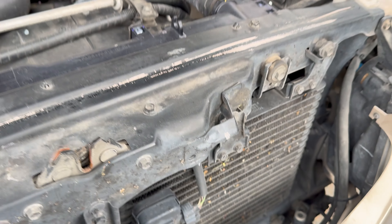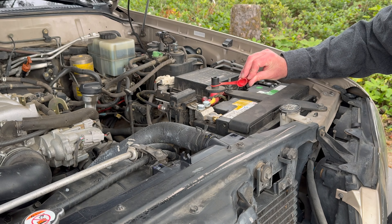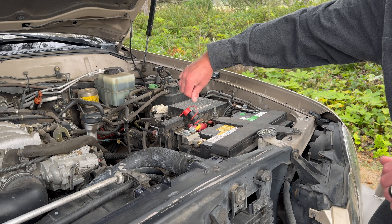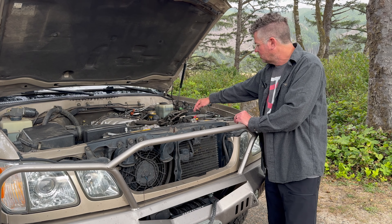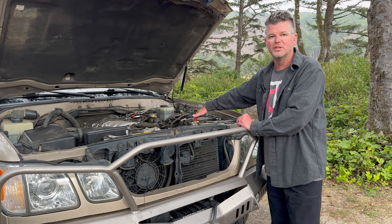I also added a switch here. This takes a totally separate marine-style switch to bring power to the winch. It's something a lot of people don't think about when you add a winch — you're running positive cables down from your battery to the winch, and if you're ever in any kind of accident, that can cause a fire. So putting a shutoff switch really close to your battery is just a nice way to keep it safe.